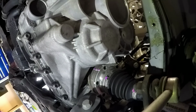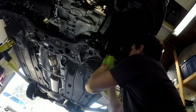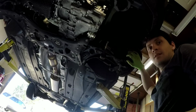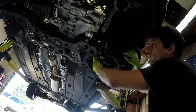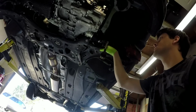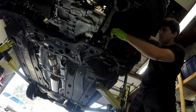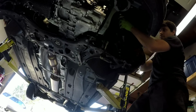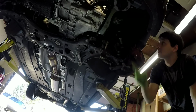So, another thing. You already took three out of the control arm, so now we've got to move the control arm. So now we can go like this, down. I'm pretty sure with the lighting kits, there's a little arm here for a level sender for your lights. So make sure you undo that 10 mil there, or you might break it. Then I get a bungee cord. It's out, it's up here. There you go. Then you have your axle out of the way.